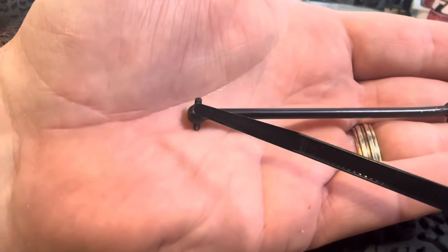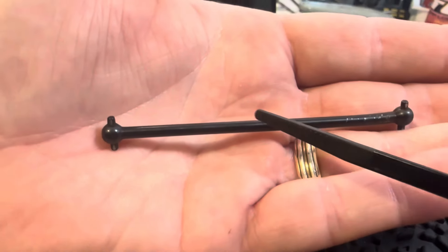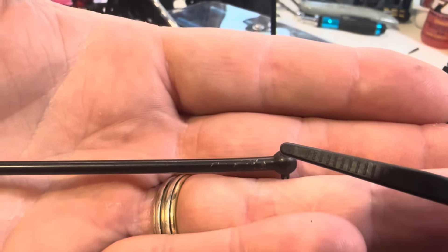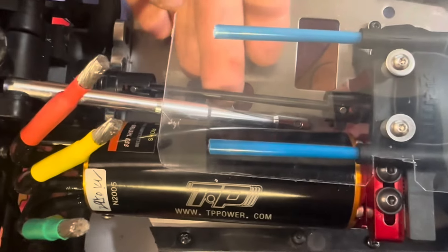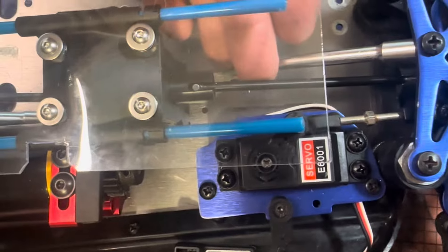It's 88 millimeters from pin to pin, then the end of ball to ball is 95 millimeters - from the very tip of that to the very tip of that. The shaft thickness is 4.3 millimeters and the pin size is 3 millimeters thick. That's what I'm running inside this here and they both fit quite well. I've still got a little bit of play - I like a little bit of extra play rather than having it way too tight.